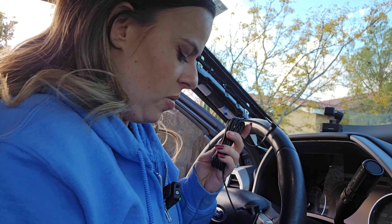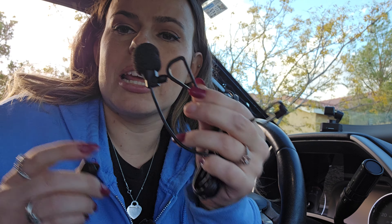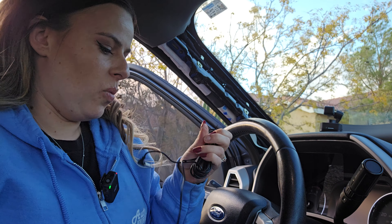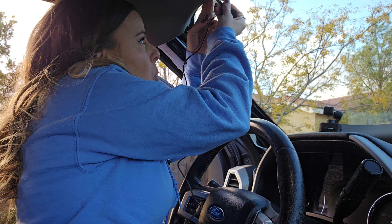With the panel off, you'll see factory wires on top of your airbag. Make sure your external mic wire runs along the factory wires — you do not want it tangled in the airbag. You can use zip ties or tape. The external microphone comes with two attachments: a clip and a 3M tape piece for mounting to glass. I'm using the clip so we can remove it later. I'll start by positioning the microphone where we want it.